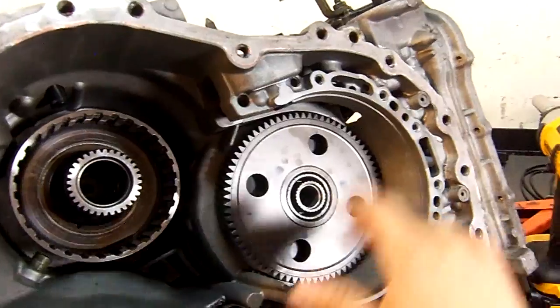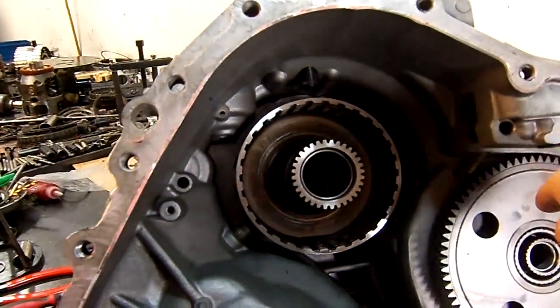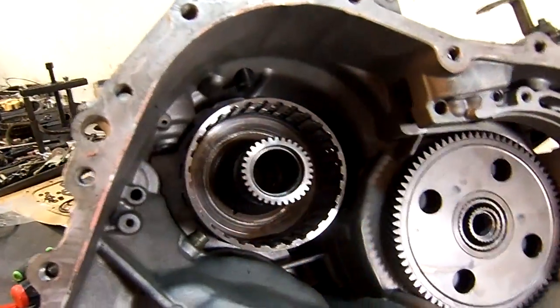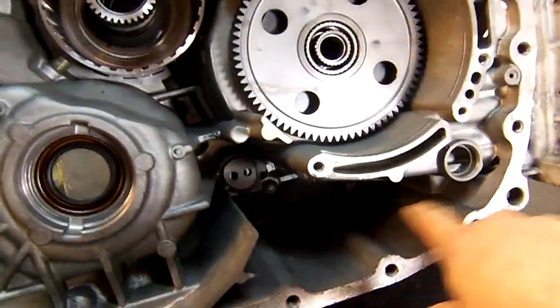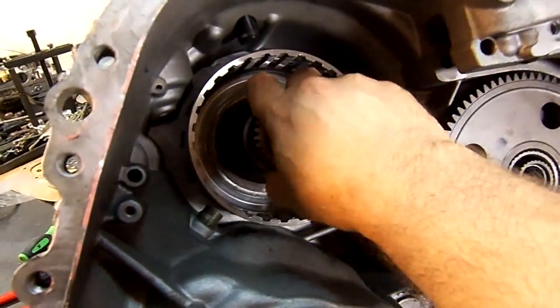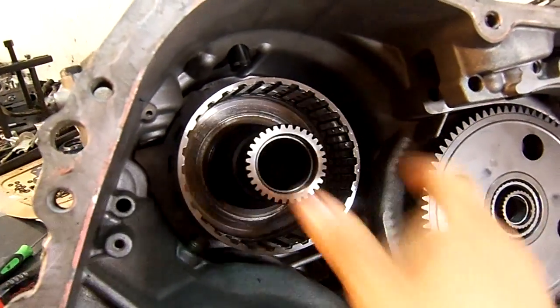You have your normal pump here, but this one has a pipe that goes from here to the pump — it's a little different. Then you have your transfer gear, final drive gear, and your normal filter down here like you see on the four speed. So there we go — F5A51 or F5A5A, sometimes it's called like that.